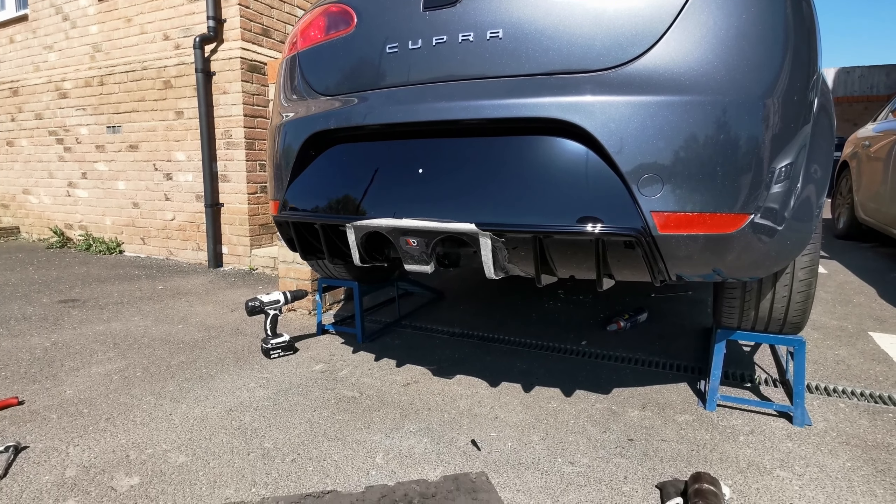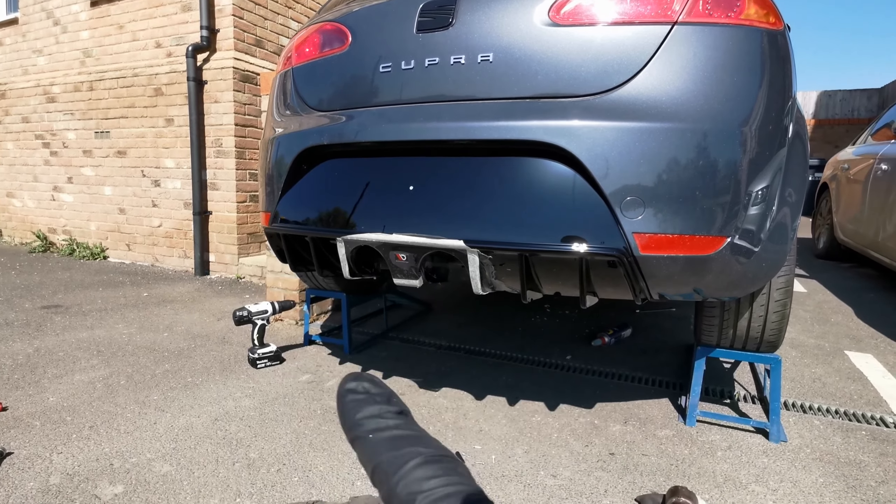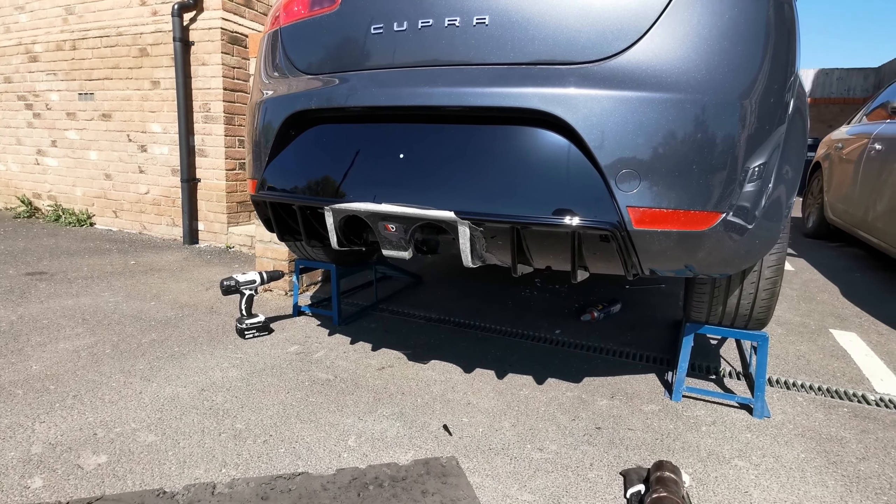We're all done with that. It's all glued on and we're just waiting for it to dry. I took the plastic film off around the outside because I wanted to see what it actually looked like as a final finish. I've left a bit on around the exhaust tip area just because I'm going to be working on there the next couple of days. I've managed to get it all fitted and it's all just drying now. Once it is dry, we've just got to wait for the exhaust parts to turn up and then it's a case of starting to build it. I'm really happy with the fitment. It's not too complicated as long as you've got it all lined up before you stick the Tiger Seal or CT1 or whichever sealant you want to use. I drilled one hole in the middle, put a self-tapper in, then spent about 5-10 minutes drilling the holes underneath — about 4 or 5 screws go in there. I've also spoken to a company which is going to supply me the correct size tips cut at the right angle, which is the 45-degree angle we measured earlier.